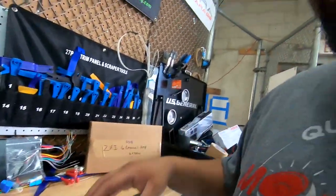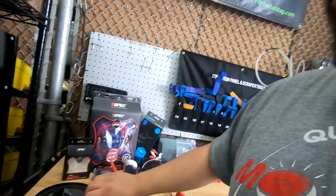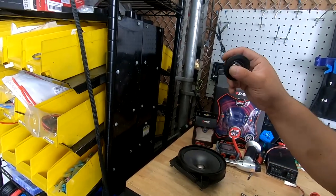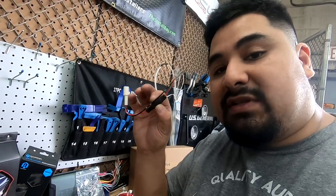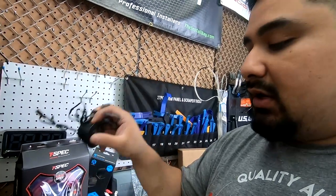I just want to make you aware that if you don't put some sort of protection on your tweeter, it's going to blow up. Also, if you're doing this with a 6-channel amp, you're going to want to connect these together using the same output from the amp, and in order to do that, you're going to need to protect this tweeter. Out of the factory wiring, the tweeter and the woofer get their own separate lines. You can keep it that way, or you can put them together, but then when you connect the tweeter, there needs to be either a bass blocking capacitor or something to protect it. This is the inline crossover for a Pioneer, so these actually go together.